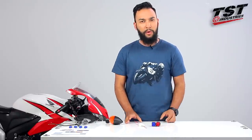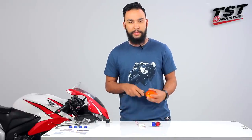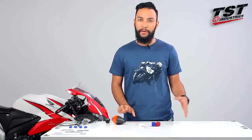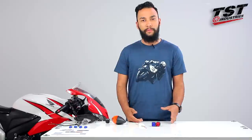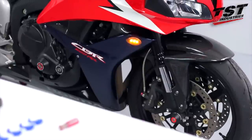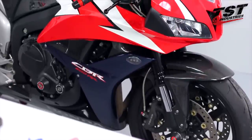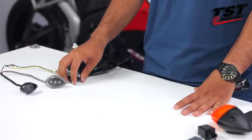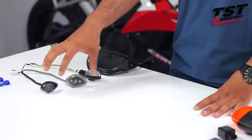Here's a rundown. Most of today's sport bikes include incandescent bulbs for their turn signals. As we all know, these bulbs can and will burn out over a period of time. To alert the rider of a blown out bulb, the bike's OEM relay will force the signaling circuit to flash quickly — something we like to call a hyperflash. This can cause a problem when you want to switch to LED turn signals, which can be found in our integrated taillights, our pod signal kits, or any of our front flush mount signals.